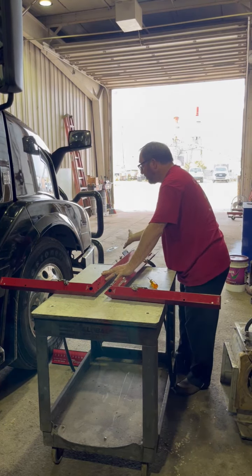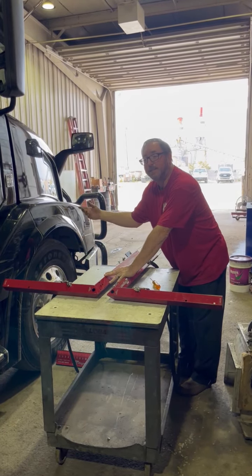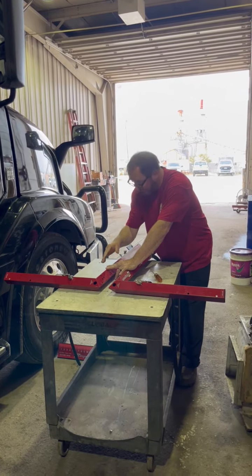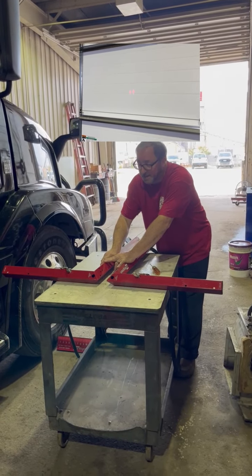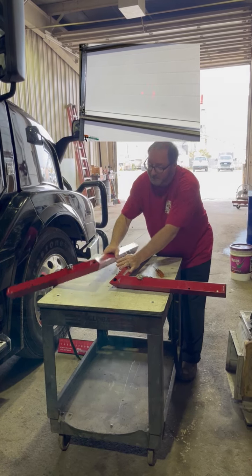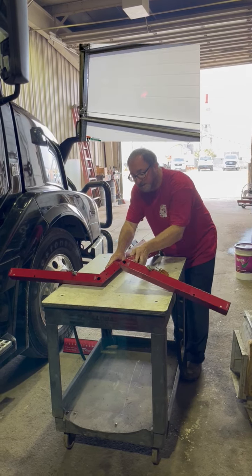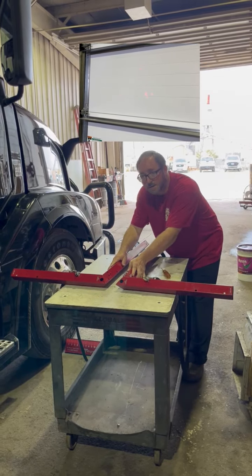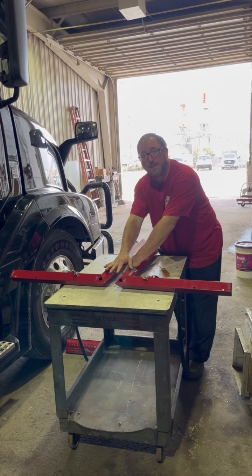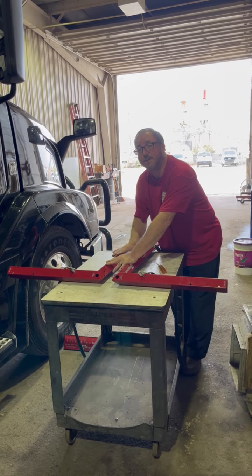If they do, they're pointing toward or away from this axle equally, and that means it's a calibrated system. Up there on the wall I've got two lasers — they're both at the same height, both next to each other. And when we do our slam test like we did on the tires, they stayed right where they're supposed to be. So we've got a perfectly calibrated, stable, consistent system. You should be able to have confidence in your calibration just like that every time you do an alignment.